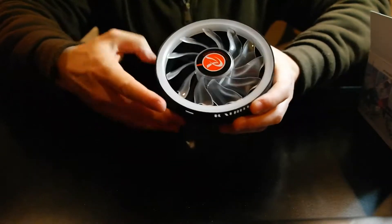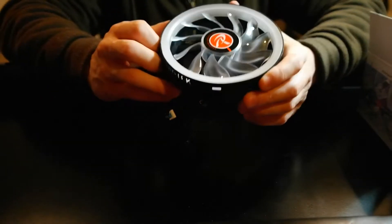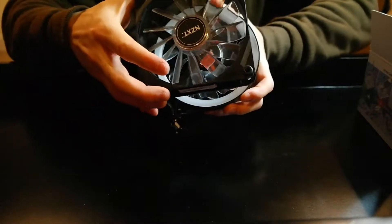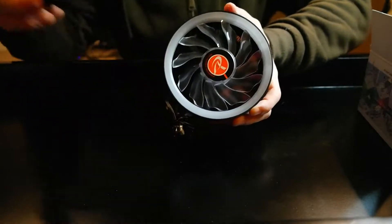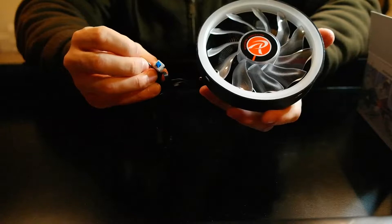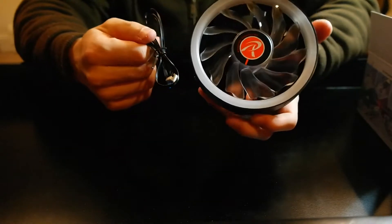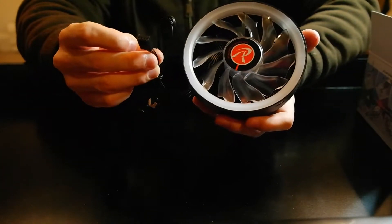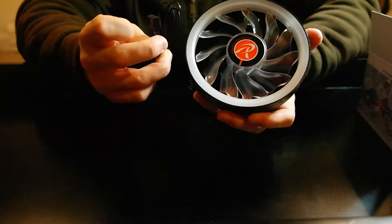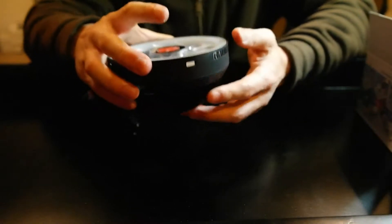Here's the cooler — you can see the Raging Tech branding. It's about the size of a 120mm fan. The Thermaltake version is addressable RGB which connects to an RGB header, but this one just has a button — literally just on and off. This one has a four-pin PWM fan connector versus the Thermaltake one which I think has a three-pin fan, so that's a big plus on this thing.